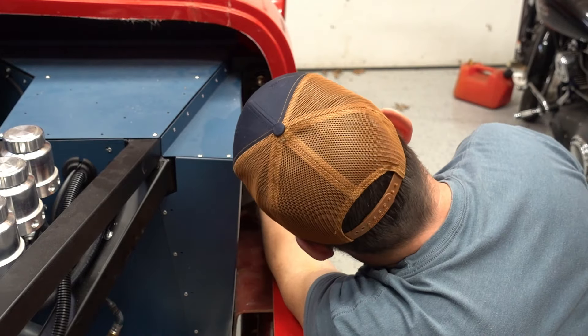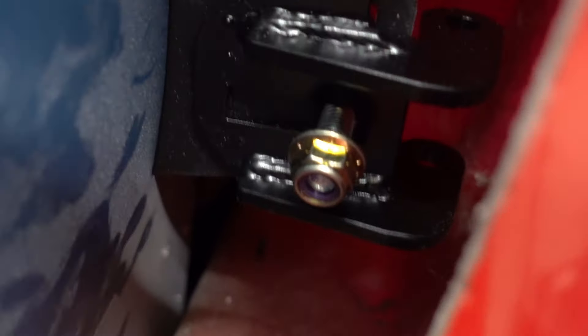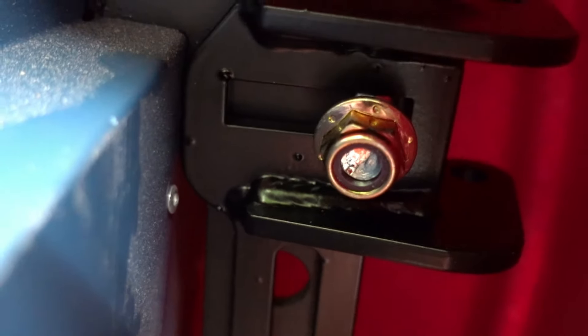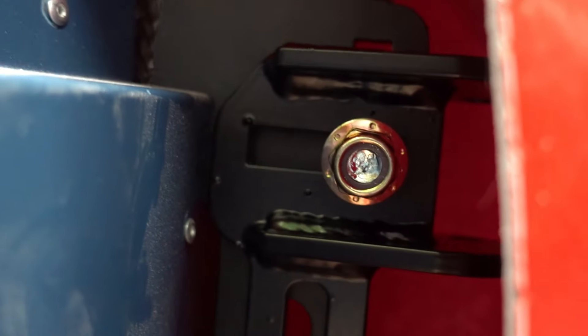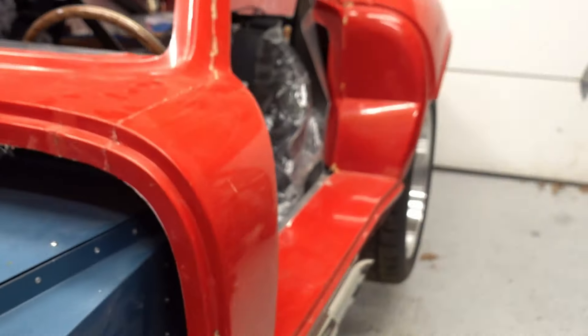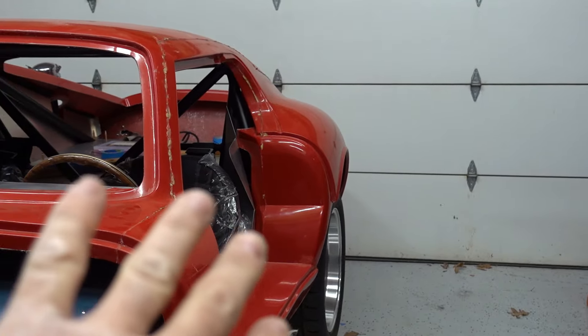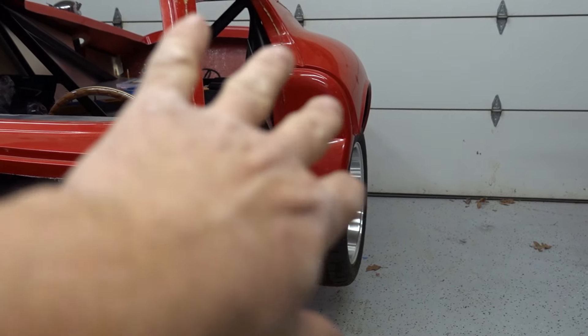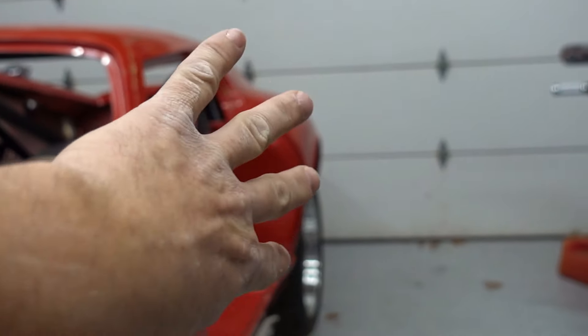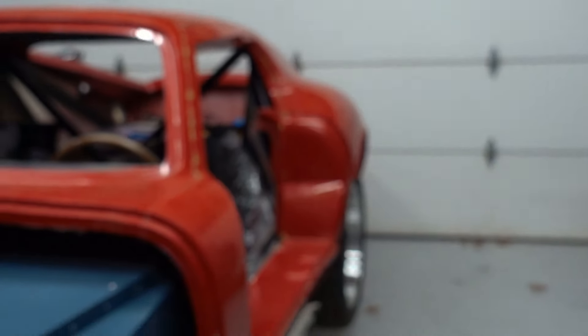Alright. Yeah, that was easy. So now they're just in there, loose, obviously. But this is how you adjust the door — you can go up, down, in, out. Top and bottom can go in and out. So you've got some pretty good adjustability once you get the door hinges on, trying to line up the door, because the door's got to go forward, backward in the right spot, up, down in the right spot. It also has to go in and out this way so you can line up the top and the bottom with the body. I'm going to go ahead and do the other side real quick and then we'll come back.